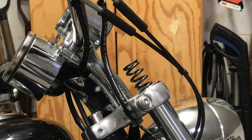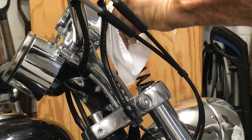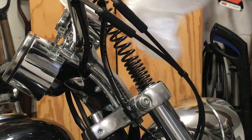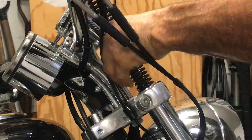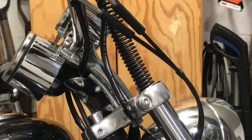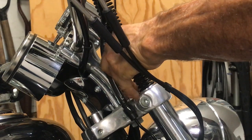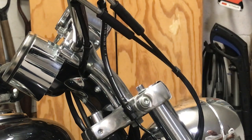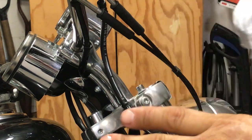I want to remove the spring and make it easier for us when we put this thing back together. I'm going to grab a paper towel and a plastic bag. I want to move it up slowly — remember the way it goes in. The springs get tighter to the bottom. Let the oil drain. I got it in the plastic bag and I put the tighter end down so I know that's the side that goes back in.